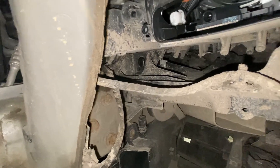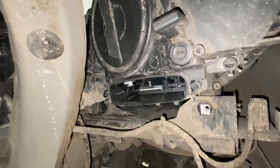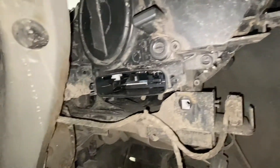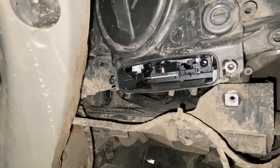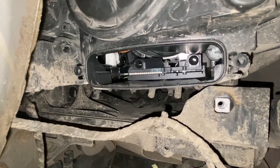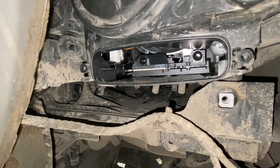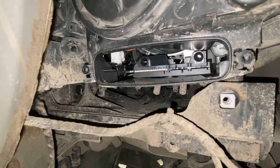There's one screw there, one screw on the inside, and then two on the outside. It's enough just to loosen the top of the bumper — but not the bumper itself, you can leave the bumper in place — and that saves you a lot of time and hassle. Obviously if we didn't find corrosion we would have had to swap it from right to left to confirm the fault first, but it seems like we've found the fault.